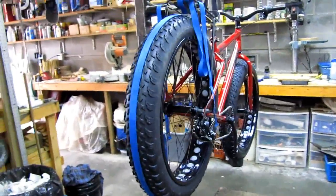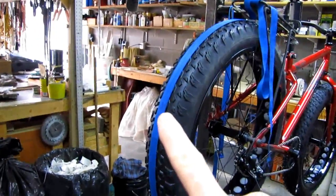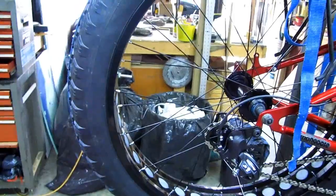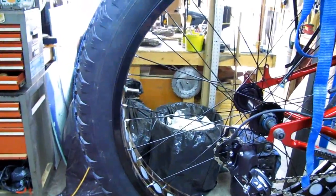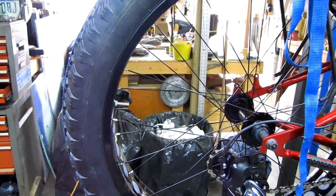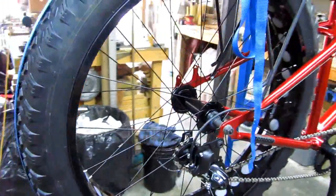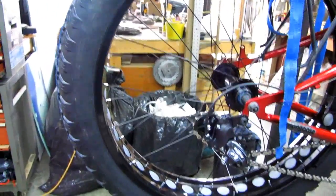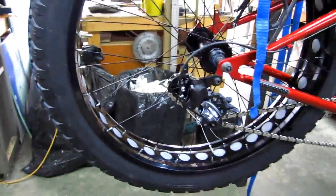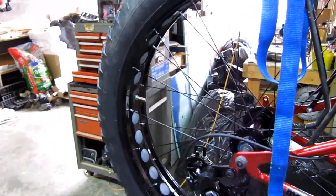I think I just had Murphy's Law on that front tire, because I put the blue strap on the back tire, tightened it down, hit it with about a hundred pounds of air, and it seated immediately — the bead popped right into place. The back tire also looked like the bead was coming out and meeting the rim better. I think a wire bead tire where the bead isn't bent would seat pretty well. I let the air out and did it again and it popped right into place, so I'm proceeding with the Stans on this one.